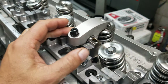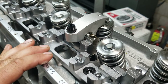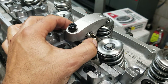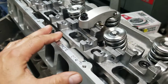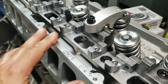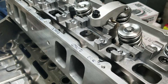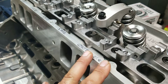The other nice feature about a shaft rocker system is it has no side-to-side play. There are no push rod guide plates needed in a system like this, because the shaft locks into a stand. This whole system is made via CNC — it's exactly perfect as per the different cylinder heads. There are many different rocker arm shaft systems, and you want to order the one that's applicable to the cylinder head that you're working with.